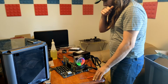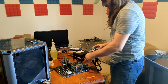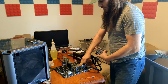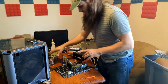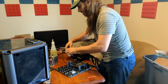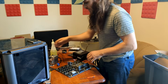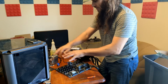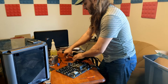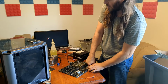Okay. There is an option. Yeah, that didn't even get warm. There is an option. Sometimes these motherboards, well, sometimes motherboards in general, will default to onboard graphics, and especially with mining boards, lock out the offboard graphics. So I might need to grab something with HDMI as an input.